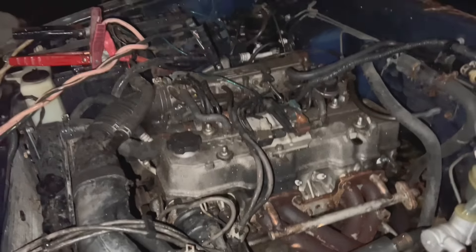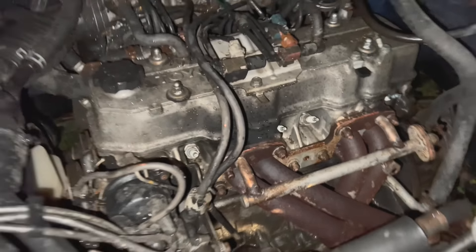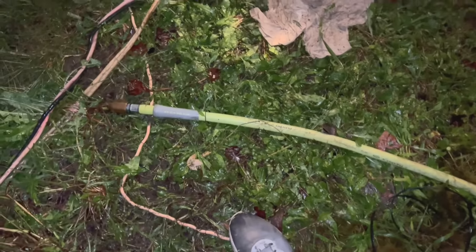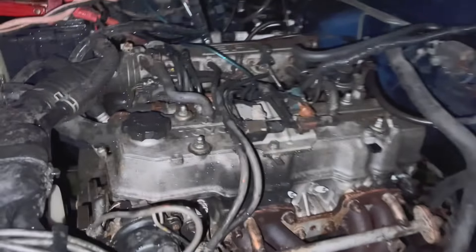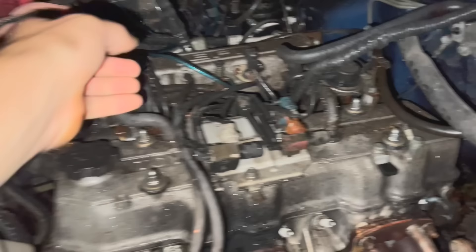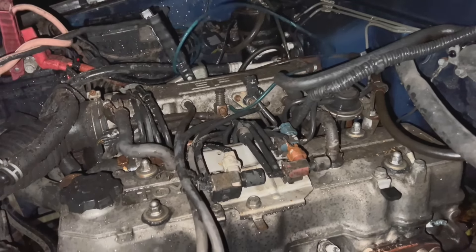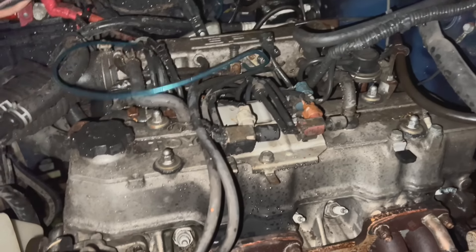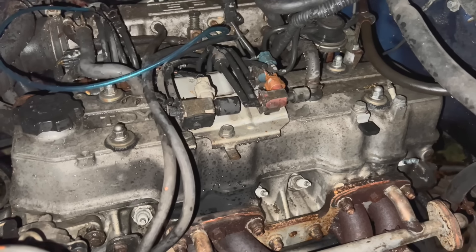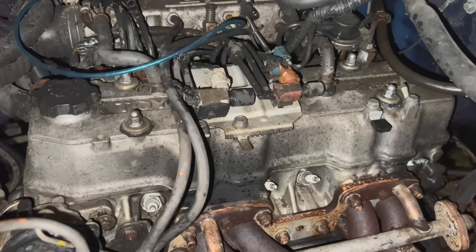You may be wondering where all the light went, why the plug wires are removed, why it hasn't moved yet, and why there's a garden hose. I got a phone call. While I was on the phone, this continued to siphon gasoline into the intake, filled the intake with gas, which filled the cylinder with gas, hydrolocked the motor. I pulled the plugs, turned the motor over, and shot some gas out.